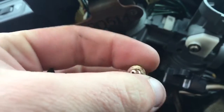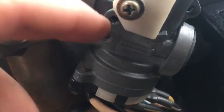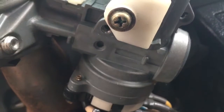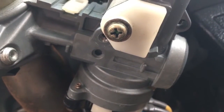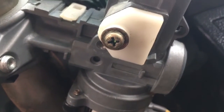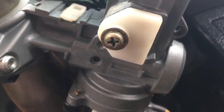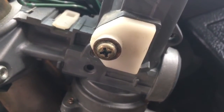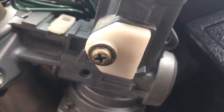So it'll look like that — just a little Phillips head. Now that that's out of your way, look back here and right behind where your screw goes in there's another hole. You're going to use one pick to push in that button inside that I showed you, and use another pick to hold it in place. Once you have it held in place, you can take the pick inside out and slide your lock cylinder back in.